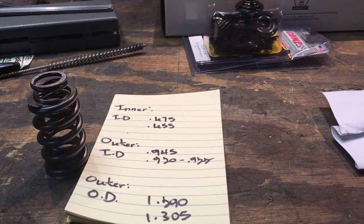Well, what this did was create a flat spot — like a hangover, like a ledge. So the inner spring that's supposed to be 675 thousandths only measures 655 thousandths. Basically, that belt sander or whatever they used — could have been an orbital sander — when they tried to doctor or treat the end of these valve springs, has made a flat surface that hangs over the inside diameters, and in some instances a little bit on the outside. So you're down 20 thousandths and your retainer can't fit inside the spring.